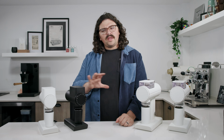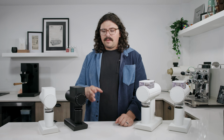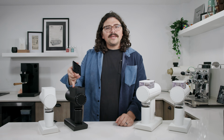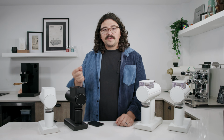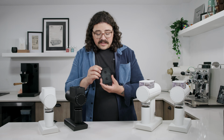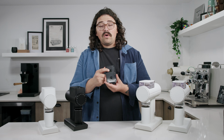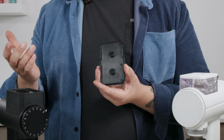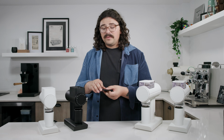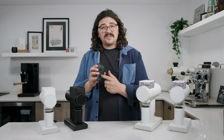This one was stalling really badly and I couldn't understand it because this is the turbo burr one, and we were at a coarse grind setting. Took the hopper off and I looked inside and I could see something was actually jammed in the auger, making it stop. And what it was was very disheartening. This piece right here somehow detached inside here. It broke off, and I've super glued it back, and it kind of worries me about potential build quality elsewhere when it comes to these plastics.